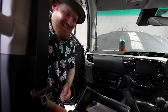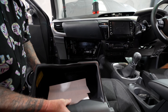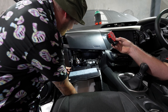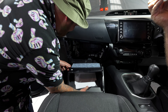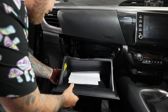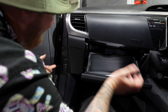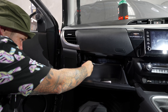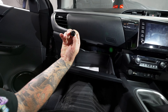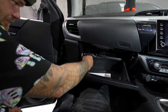Once the earth is connected, the switch connector will only plug in one way and you'll hear it click. Push the center panel back into place — don't forget to put your zip tie underneath the steering column. For the glove box, line all the clips up. You'll need to pull the top section away to tuck the bottom section underneath, but once it's lined up it just pushes back into place.